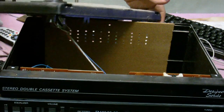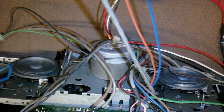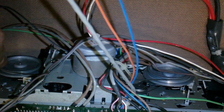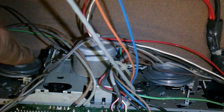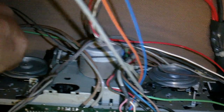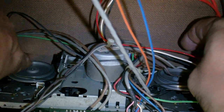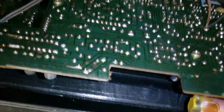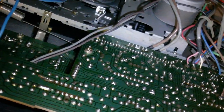It seems to be very simple inside. There's only one tape motor — it drives both tape decks. You can see when I turn this wheel, the other one is also turning. Don't know how good the belts are; there doesn't seem to be much tension, so they may need replacing. There are two main circuit boards — this is the main one right here — and there's another one behind it, plus a tiny little transformer.